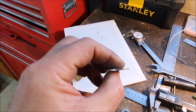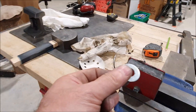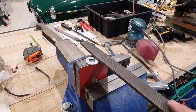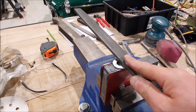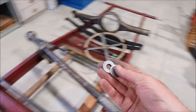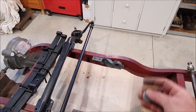You can see these have been filed so there's actually a taper on them. They're relatively flat on the top — not perfect, but reasonably good. The way I did that was using this magnet. I'm able to hold the washer with the magnet and then carefully file it — I say carefully because files are steel and so they get attracted to the magnet, so you just have to very carefully file it. I'm also using the random orbit sander, which takes quite a bit off, and then flattening them on a piece of 240 grit paper, and that gives me the taper I need. So I can slide those in between the chassis rail and the casting to take up the gap between them really nicely, so it's all going to be bolted in nice and firmly.